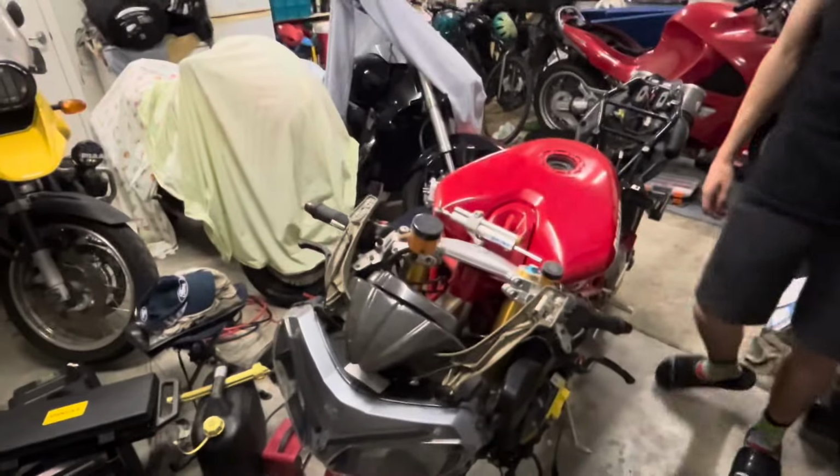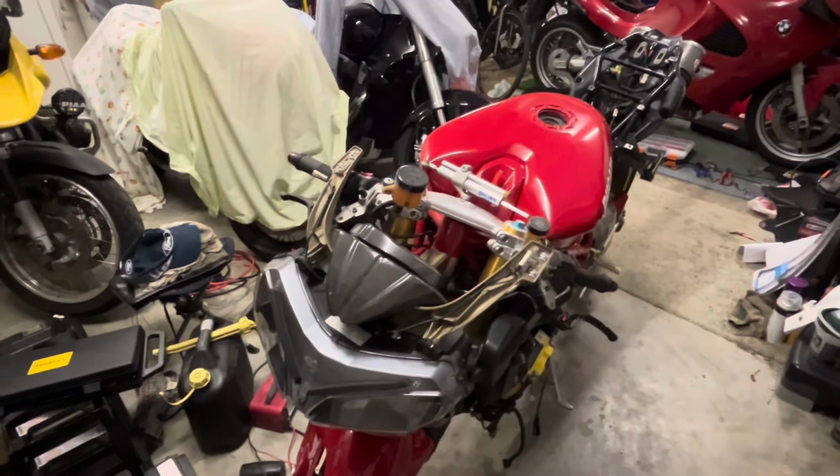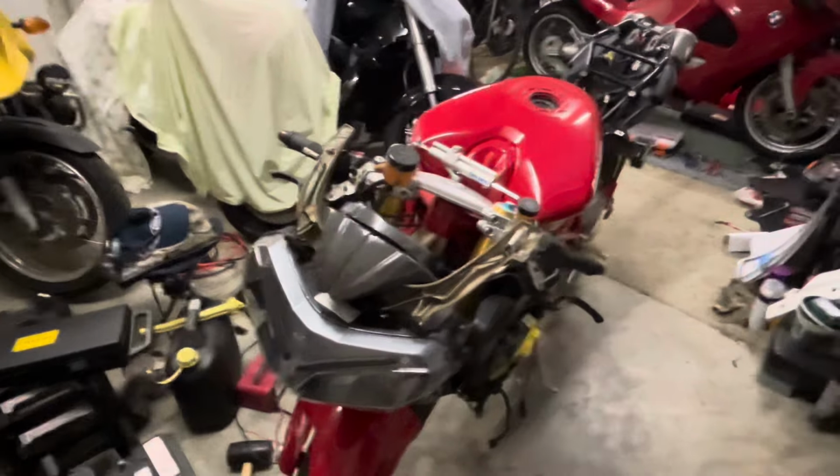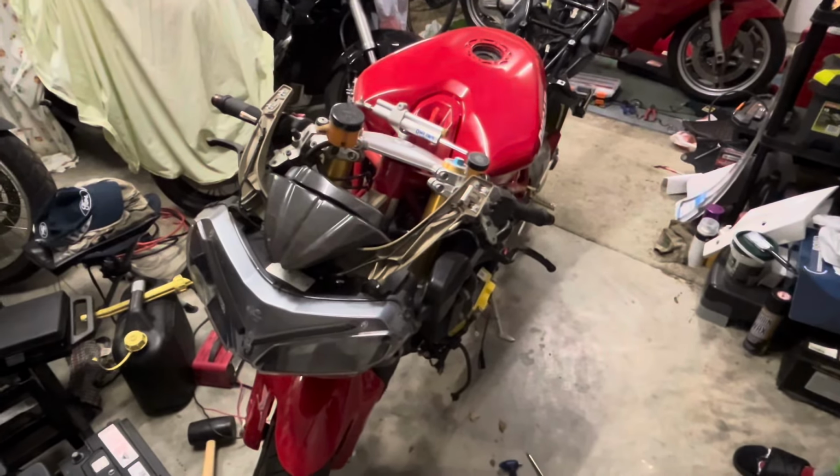No. Right. Okay. Well, guys, we've only waited 2 weeks for that solenoid to arrive just to tell us that we don't know what's going on still. So, must be the switch, which I sort of thought when I couldn't get any power at the switch. Remember, I tried to get continuity, couldn't get it, and then I second-guessed myself and said, oh, don't worry about that, it must be the solenoid. Now I'm thinking it is the switch. Righto, we'll try that again, see what happens with that.